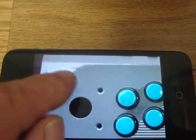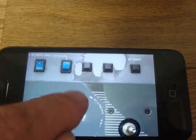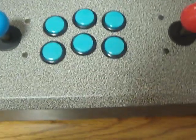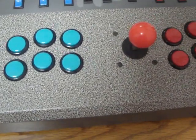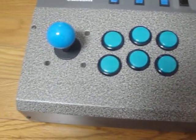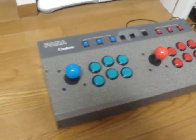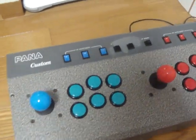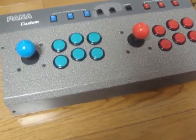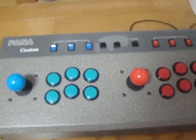After the paint dried I wound up sanding it down even more to get it really fine, and sanded down the sides to get it even better. You can see up at the top that's still some bare metal. I wound up getting some vinyl for this, cut it out, desoldered all of the buttons — which was really a pain — took the joysticks out, cut the vinyl to the right size, and put it down there. I was able to get the control panel looking a lot better than it originally did, aside from the top part where the start, credit, and second-player buttons are.